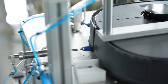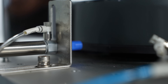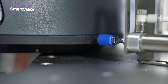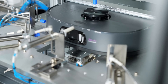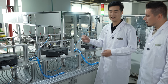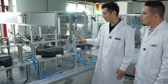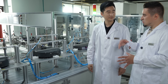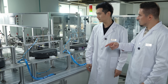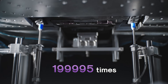There's also a collision testing section with rigs set up to collide the robots against blue pins. Mr. Lee explains that while robots have many collisions in general, the most stress happens on the main wheels and front bumpers, so those are specifically tested to a higher standard. Push bars from above, around, and below simulate collisions — like hitting chair legs. Each component is tested over 200,000 collisions, using a built-in spring mechanism.